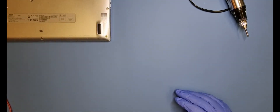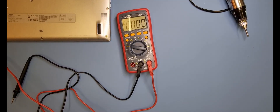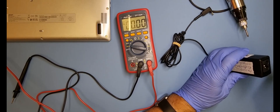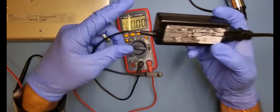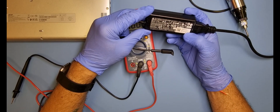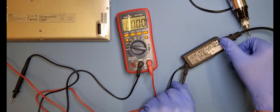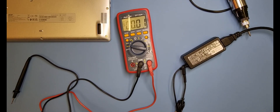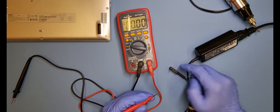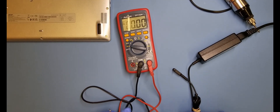Okay, let's get that out of the way — get the multimeter. So the old charger is here and it's the right one; I've checked before. It's 19 volt with 2.37 amp output, 45 watts, so it's the correct one. I haven't got a pin thin enough to get into the hole to the positive terminal, so I'll just use a paper clip and connect to it.